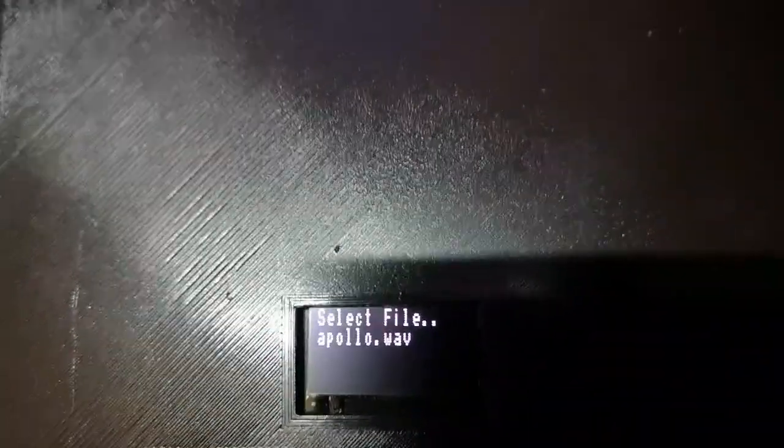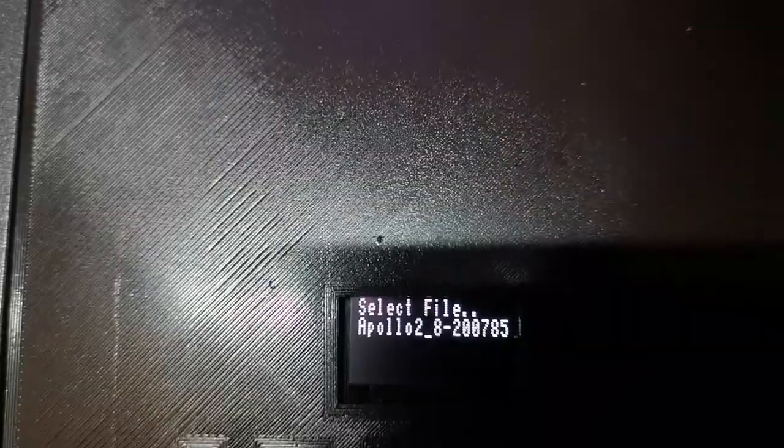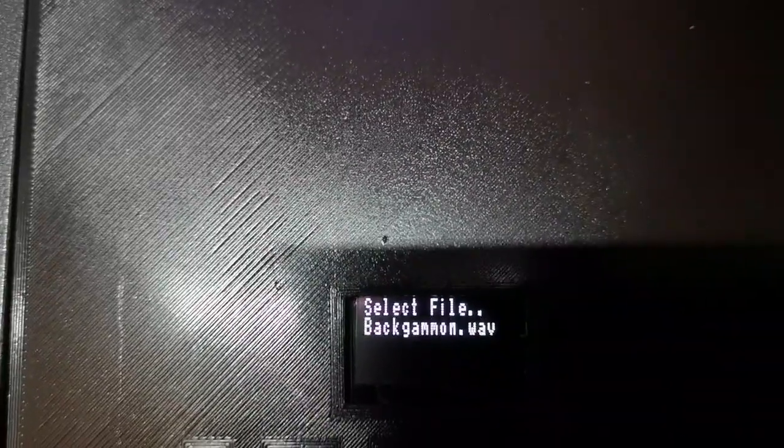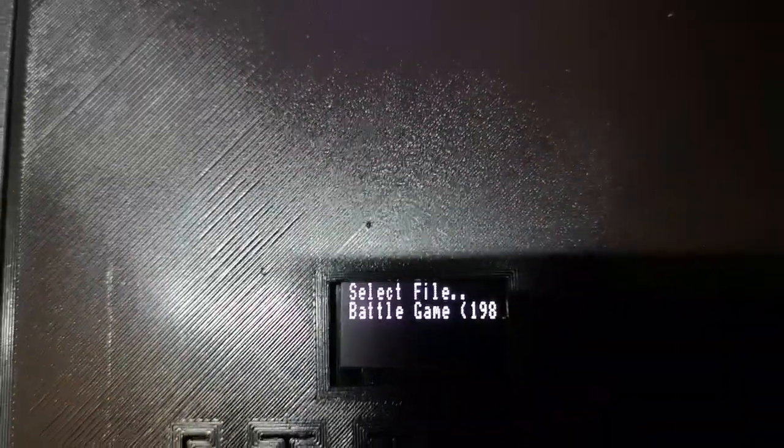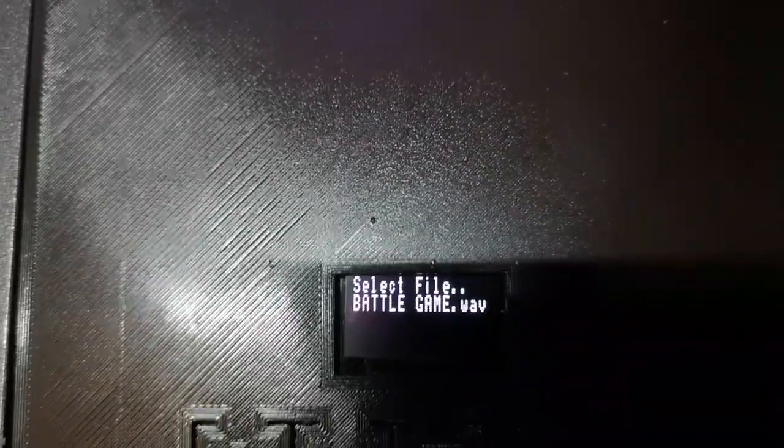This is quite a loaded card that came with it, which is the option I asked for. But you can drop your own programs onto it via a PC — they're all WAV files so it's quite easy to get hold of, and you can download them on a lot of the MZ websites. The biggest thing on here is BASIC, which is good because my copy of BASIC is a bit flaky on cassette, so it's nice to have a copy on file. Once you've chosen your program, you load it the same way as you would on any other cassette.